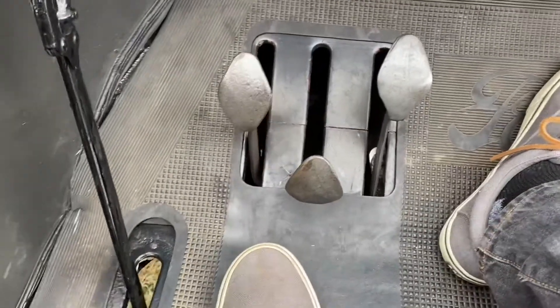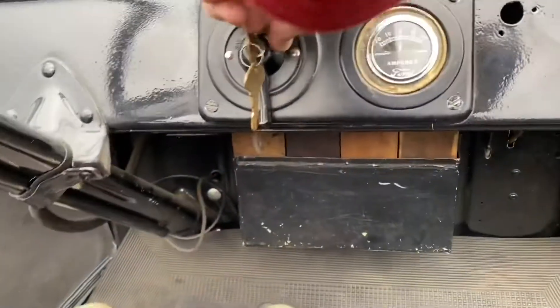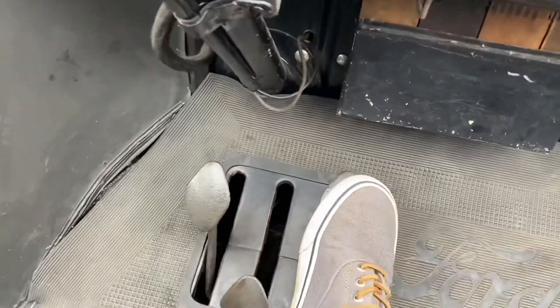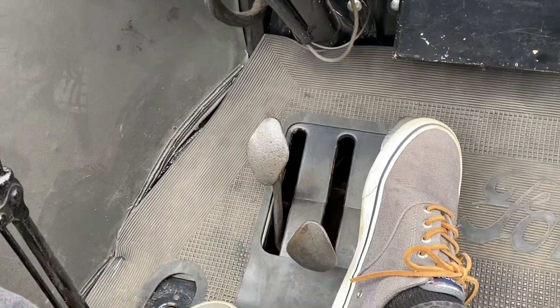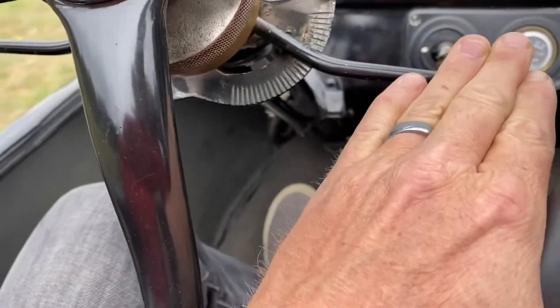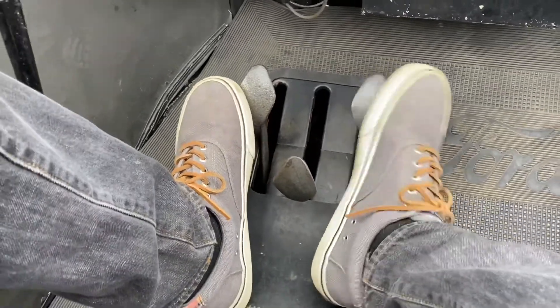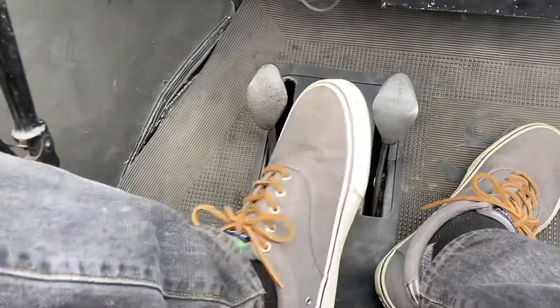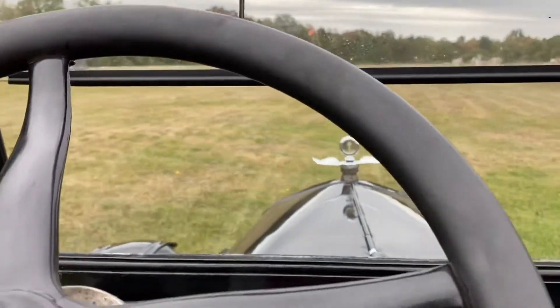We'll put the car in neutral by putting the parking brake up, which drives it to the neutral position. To start the car, you can hold down on the brake. I'll turn the battery on — there's a starter button on this one, so I just push down on the starter. Pressing down on the pedal while upping on the throttle here engages the low speed. Now that's neutral. I can push on this one — that's the brake band. And here's the reverse; it has a bit of a weird angle, and you almost have to tip your foot sideways to get it to work. So that's reverse.